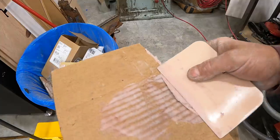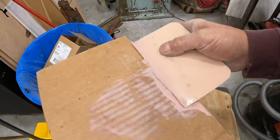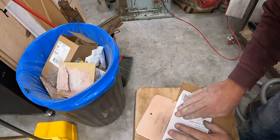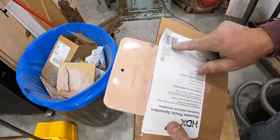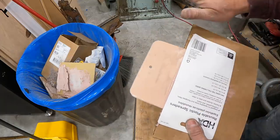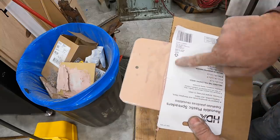I have just a little bit left, and the best way to keep your squeegee clean for your next application, garbage, and basically use whatever's left over from your previous pour, stick it to both sides, and then when that cures, it'll peel off all the debris. You won't end up with this little spickly stuff at the most important spreading edge.